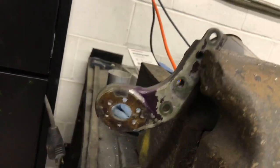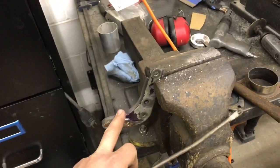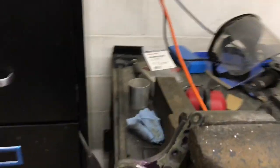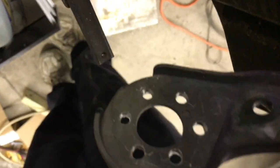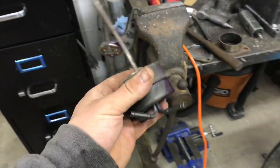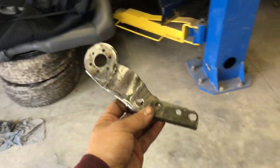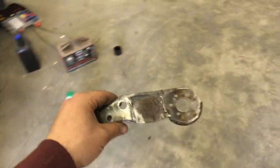Here's the bracket for the original wastegate for the CT26, and here's the wastegate itself. I've separated the wastegate from the CT26 OEM bracket. For anyone who wants to do this, there are four points where it's been welded onto the bracket, and then there are six spot welds you're going to have to drill out on this side — that's what secures the wastegate actuator cylinder to the bracket. Now that I've got this off, I can figure out where I want it and make a new bracket to support it. Here's the extender bracket for the wastegate actuator, all welded up with the spacer in there. Now going to install the actuator itself and see how it turns out.